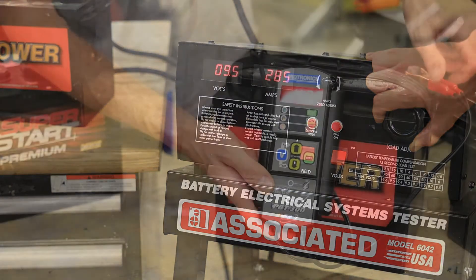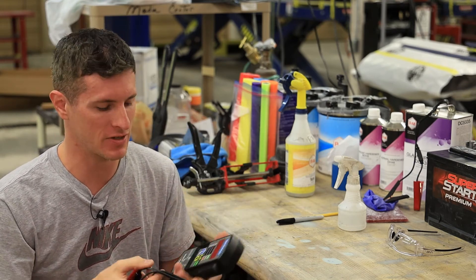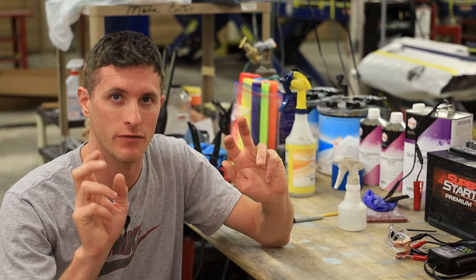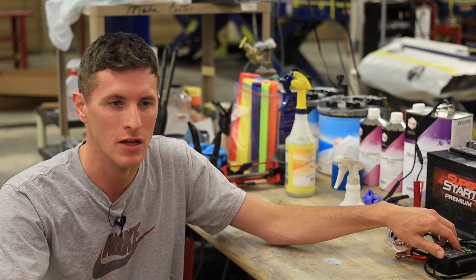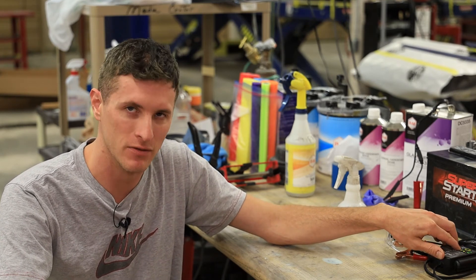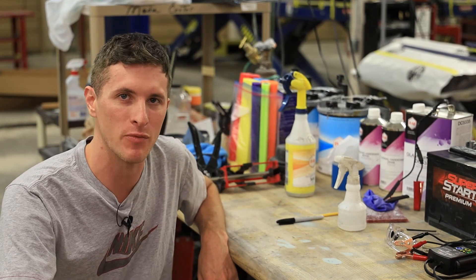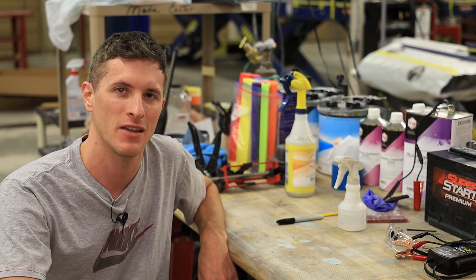There you go folks — pretty easy with the Midtronics tester. It suffices for about 95% of the battery testing we do here in the shop. I still like my carbon pile a little better. If you do want to use this tester as a load tester, put it in volt mode — like you saw at the beginning of the video where it read 13-point-something — then disable the ignition system and crank the engine for 10 to 15 seconds. That will put a load on the battery and you can monitor voltage for a pseudo carbon pile test, although at the expense of your starter motor. Give us a thumbs up, leave a comment below, subscribe to the channel, and as always, thanks for watching.